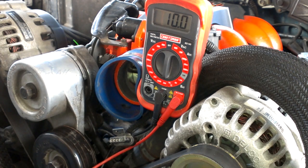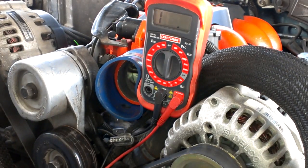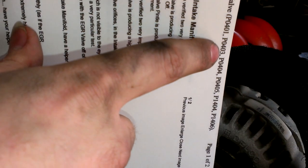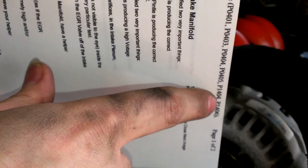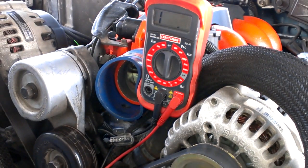That's a little high — it's at 10 ohms. But this is a generation one OBD1 EGR. Now, this is all based on OBD2 because it gives you EGR valve codes P0401, P0403, P0404, and all that — those are EGR valve codes. So mine might be a little different on the ohms or resistance.